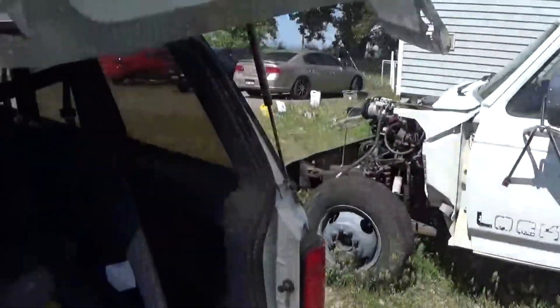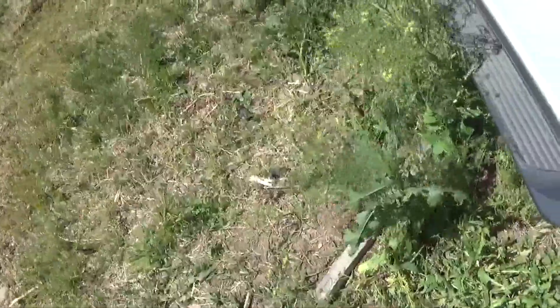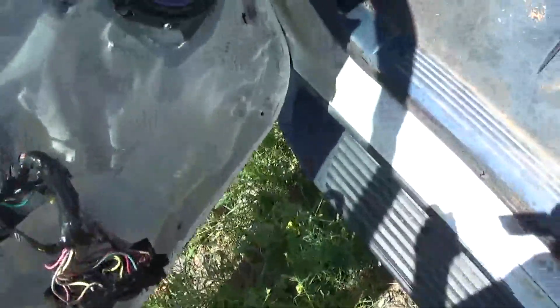The clip for the lock mechanism here — you can see the lock just sitting all by itself. There's supposed to be a clip that sits right here, and the little arm comes out and hooks onto it so you can unlock and lock the door manually. But you can't do that right now. Also, all the doors will lock but won't unlock, and I'm betting it's because of this thing — it's missing a section of it.